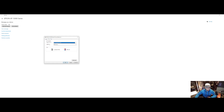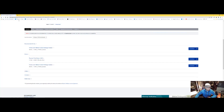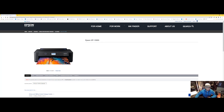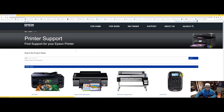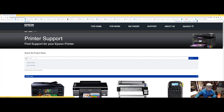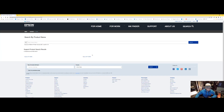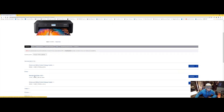Your window should not be looking like this. What you want to do is go to the Epson website — go to Support, go to Printers, do an XP-15000 search. It's the same for the ET-8550. Go to Downloads, then the Drivers Utility Combo Package Installer. Install that and follow the instructions. I'm not going to go too much into it — that should be pretty simple.